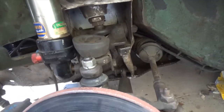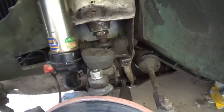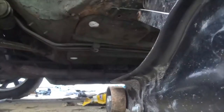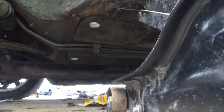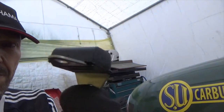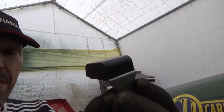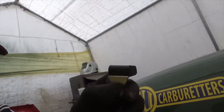I'll get these out of the packaging, compress the suspension by letting the jack down and letting it sit onto the axle stand, and then we'll get one of them put in on this side. There we go — a little polyurethane bush. These were £8.50 from Mini Mine. £8.50 and a ten minute job to improve the handling of your car — it's a no brainer.